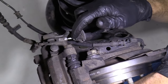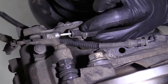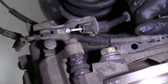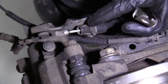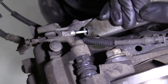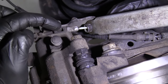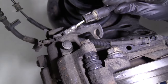We have our emergency brake cable. It comes through this bracket on the caliper and hooks onto this. The e-brake cable generally will have something that holds the cable to the bracket, whether it's a clip that slides in or a couple of ears that you need to squeeze in. There are multiple ways it could be, but whatever holds it in, you need to make it so you can get this cable out. For this application it has two ears you need to squeeze, so I'm going to use this tool. It just slides over the cable — slide it right down there as far as you can so it's up against this bracket.